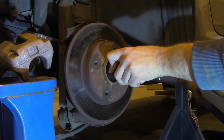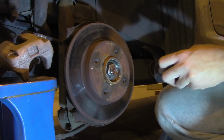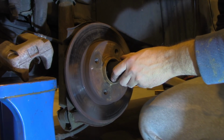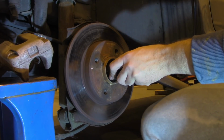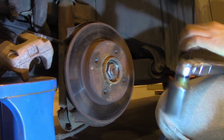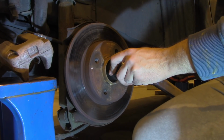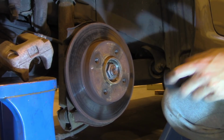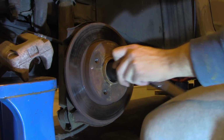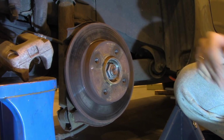And I will also check what is the momentum. Now we are on 90 Newton meters. Set it on 120. Almost. Okay, we're on 120 now. 150. Almost. Okay, I guess 160. It's gonna do the trick, I hope. Yes, it's basically in the spot where it was when I removed it.